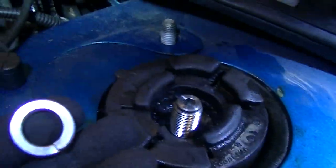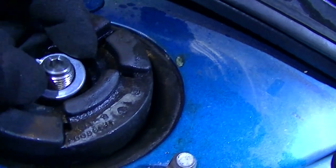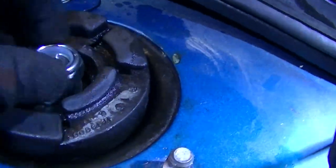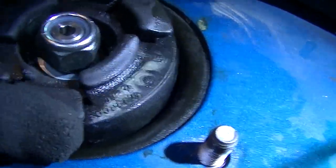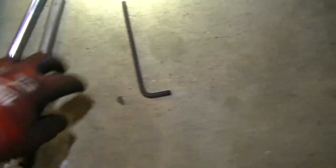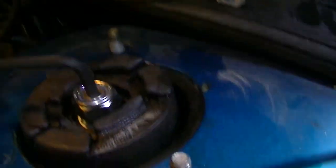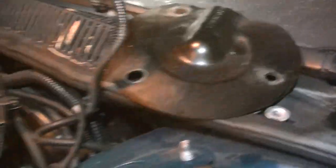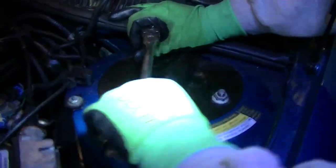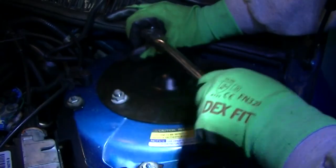The only thing left is the lock nut — the lock washer and nylock nut. We're going to tighten these up. It is a 6mm Allen wrench, as demonstrated by that. We'll tighten that down and then put the cover back on. The cover plate goes back on, and in some sense it holds that big rubber isolator on, because the isolator kind of started to creep back out as we were tightening the nut on the top of the strut.